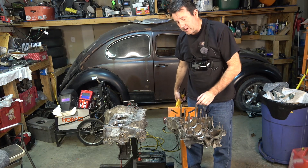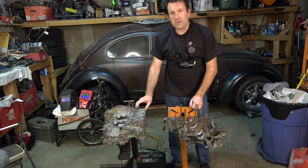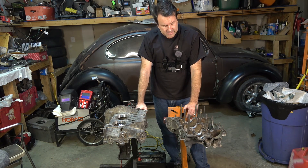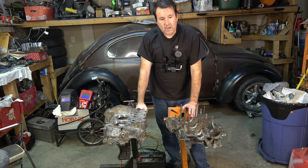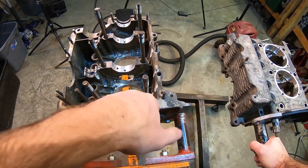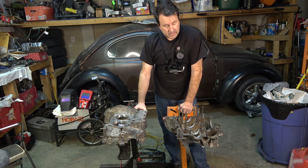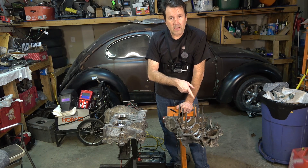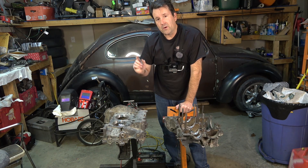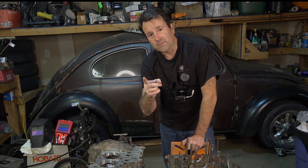That's all it takes — doesn't take much at all. It actually takes longer to find the drill and the bit and put it on than it does to do the job. I still have to fit the crank and stuff — I'm going to vacuum everything really well, clean up my mess, and then get on to the next thing. What I'll probably do is just throw the rear main and front main on and set the crank in, check it's not hitting anything. If I'm happy with that on both halves I'll mount the rods and do it again, then fit the cam and oil pump. That's all for future videos — if you like what I'm doing, be sure to subscribe so you don't miss out on the buggy engine build. Keep cruising, keep shifting those gears, and enjoy the ride!